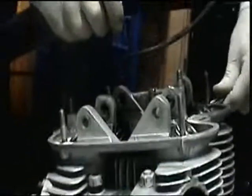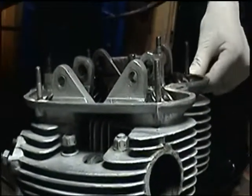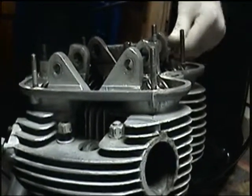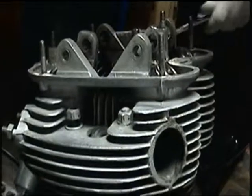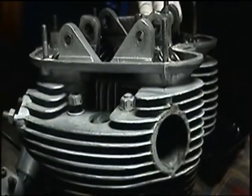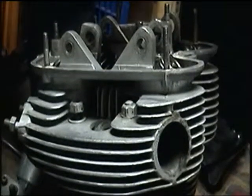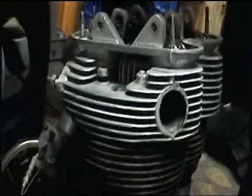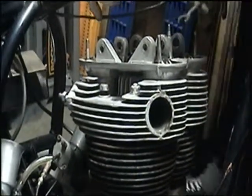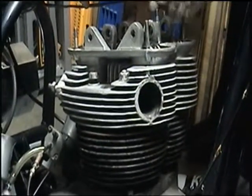rings. I didn't do a leak down test because I plan on rebuilding it anyway, but you can do a leak down test and it'll tell you if air comes past your valves, then you got bad valves, or if it goes past your rings, etc. You can tell by putting your hand over the exhaust. If air is coming out of your lower end, the bottom end's all stuff like that,